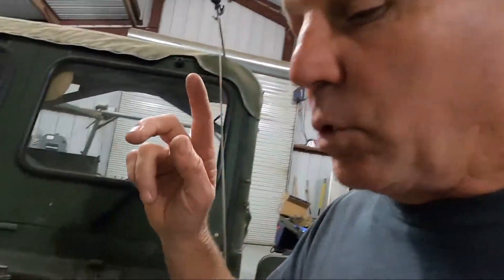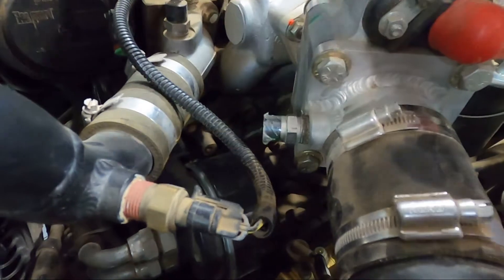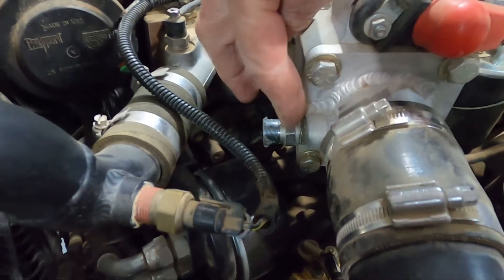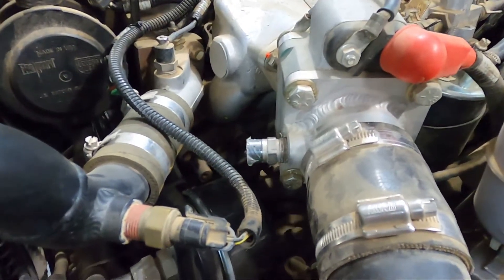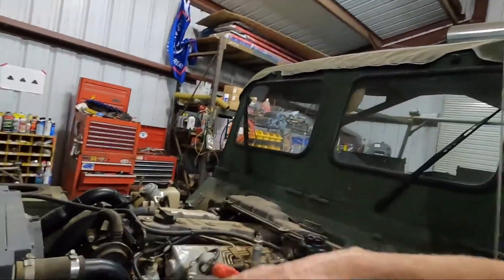You want to buy a boost gauge. This port here — there's a temp sensor for the air intake, mine's broken and not hooked up, but this is the port where I can put my boost gauge in. I have a long hose on it so I can hold it in the cab and watch what it's doing when I'm driving. That's probably the most important thing to do first: see what your boost is at, then check your air filter and check for leaks throughout the system.